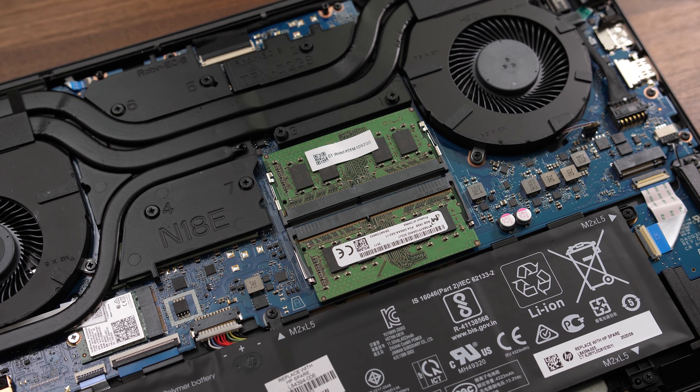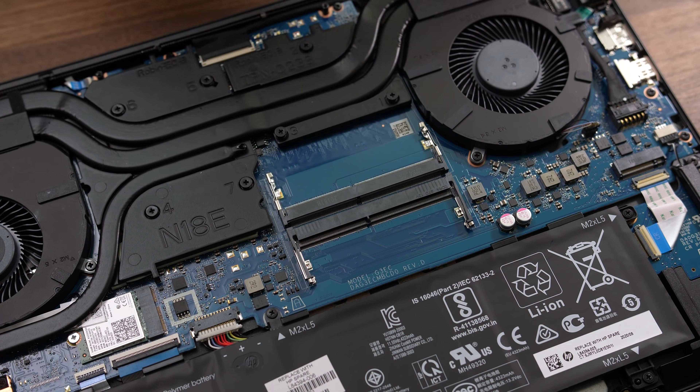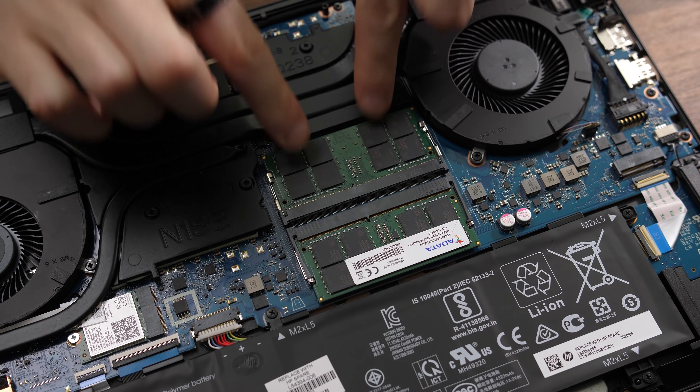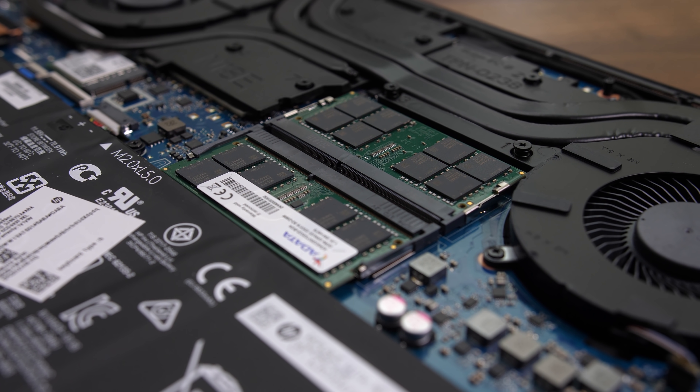Next up we'll upgrade the RAM. Mine came with two 8GB sticks for 16GB in dual channel at DDR4-3200. You always want to have two sticks installed for dual channel as this will give best performance — one stick will be slower. We could go with two 16GB sticks for 32GB in dual channel, but instead I'm going with two 32GB sticks from ADATA for 64GB in total, which is probably overkill for most people. When picking memory for this laptop the important thing is that you get two sticks of DDR4-3200 at the same size. I've retested some applications with the 64GB of memory. I haven't bothered with games, as the last time I tested 64GB there was no difference at all — there's no change to the speed or timing, so we're just increasing the capacity here.